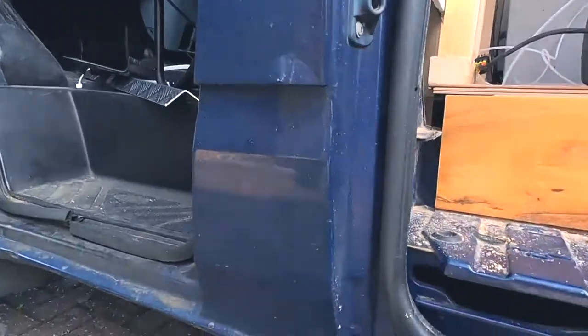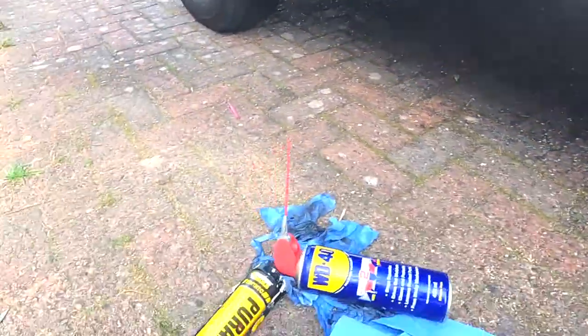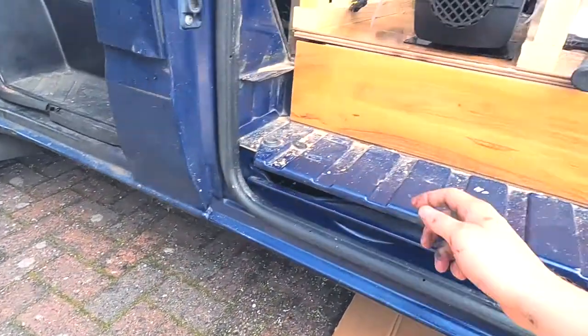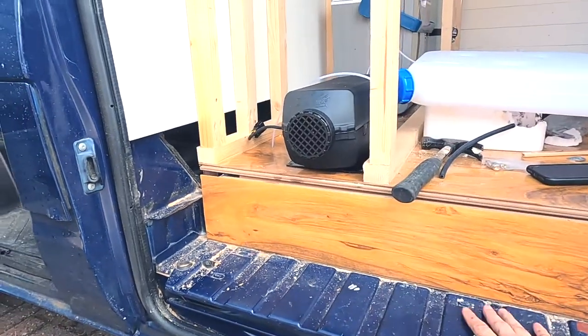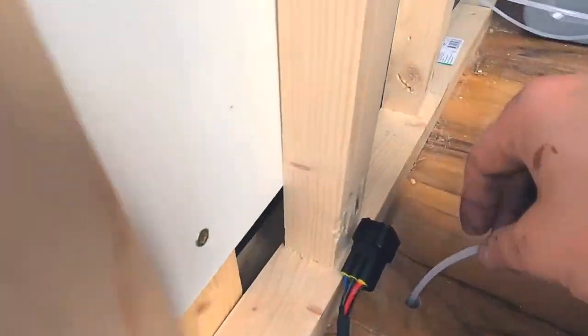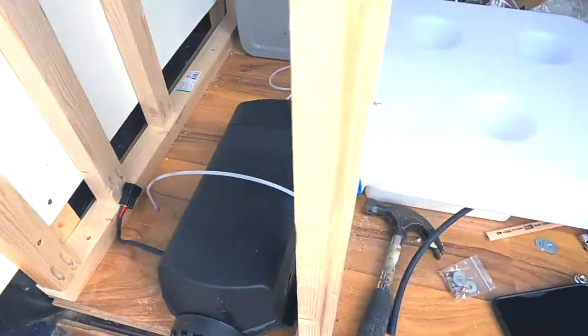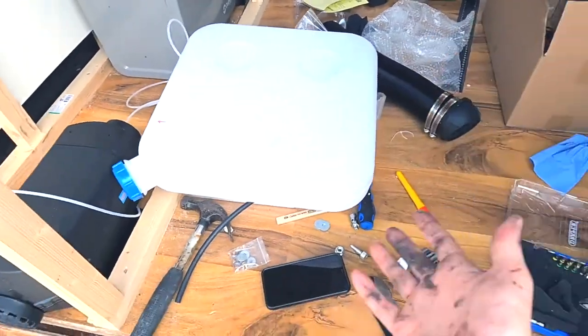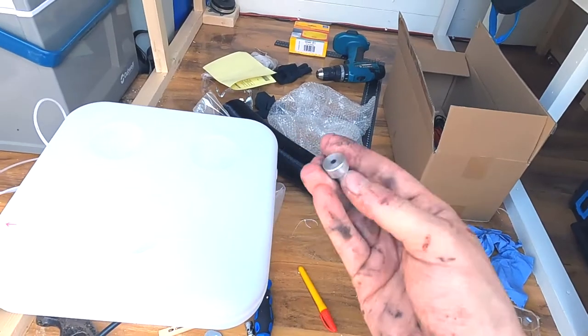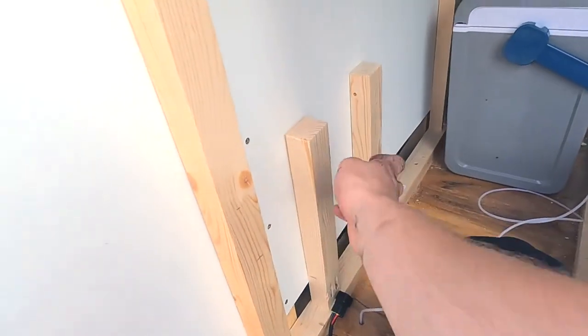But it's in. This plate, because I can't screw it down, is just glued down. It should be fine because it has a working temperature of 80 degrees — and if it gets to 80 degrees, I've got other problems like things catching fire. There's a hole here with a rubber grommet on the underneath for the fuel line, which I just need to plug into this. There's nowhere for a fuel line to go in this heater, so you have to put one of these fuel sender fittings in — the bit sits inside the tank and the other part pokes out. So I'm going to prep the tank now. I've already screwed in these bits of wood that it will attach to.